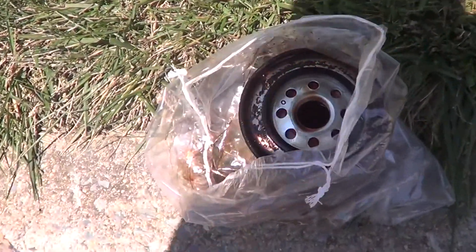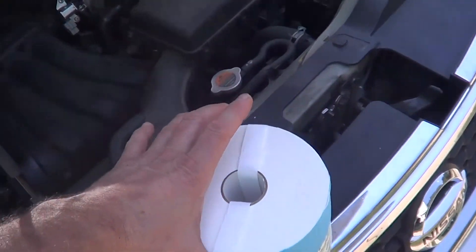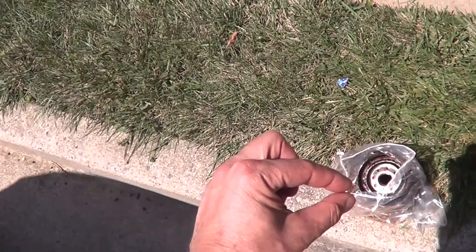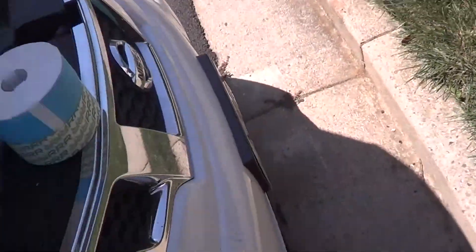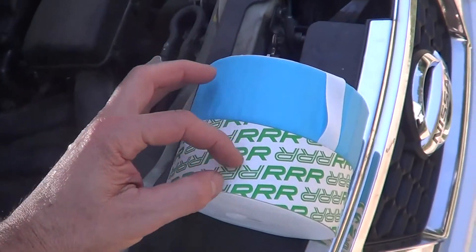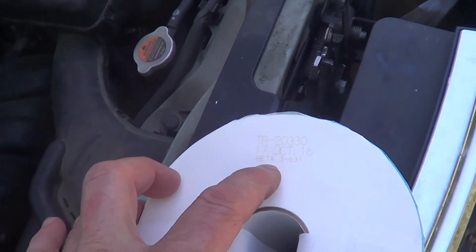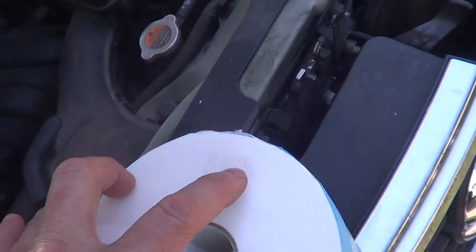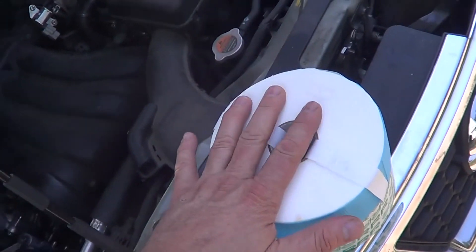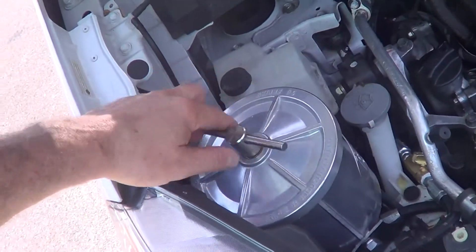That was a pleated filter — if you open it up, it looks like a standard oil filter. I'm now going to try what's called a cellulose depth filter. The difference is, rather than going through one layer of paper, the oil is going to go through about 5 inches of paper. It's called a depth filter because it has to travel through so much more filtration. This is the M-Series from Triple R, part number TR20330, rated at 2 micron. It's similar to toilet paper filters.